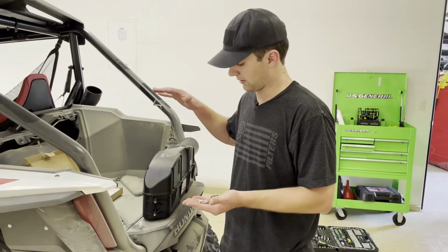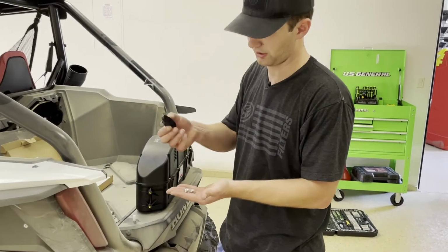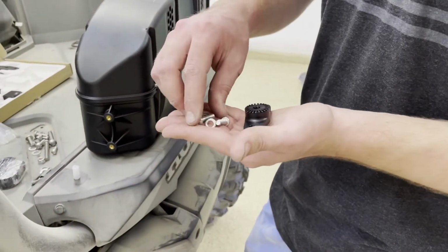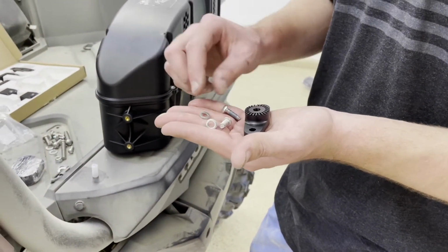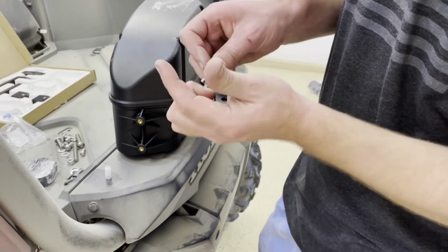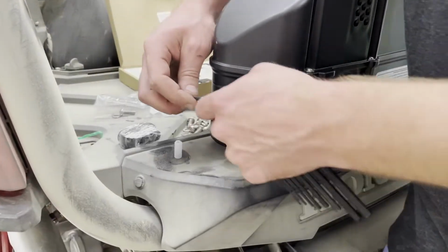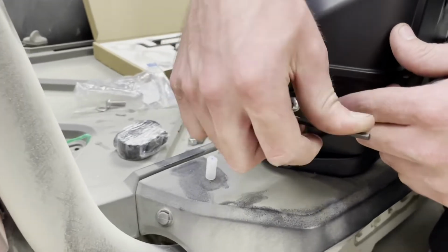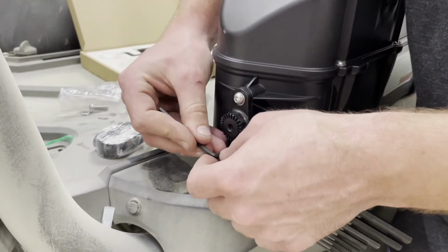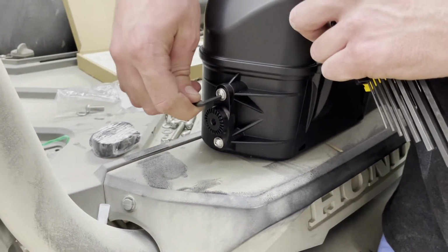We're going to go ahead and get our separator housing ready for mounting now that our clamps are installed in our cage. To do this, we're going to install 1 pivot body on each end where the brass colored inserts are. I've already got blue Loctite on my Allen head bolts here and my washers ready to go. And it's as easy as just getting these hand tight, and then we'll come back through with an Allen wrench. Using a 4mm Allen wrench, I'm gonna snug these up. Again, we're using Loctite here, so we don't need to get these super tight, but we don't need them loose either. So I don't use too long of an Allen wrench, and just when they get snug, I'm done.